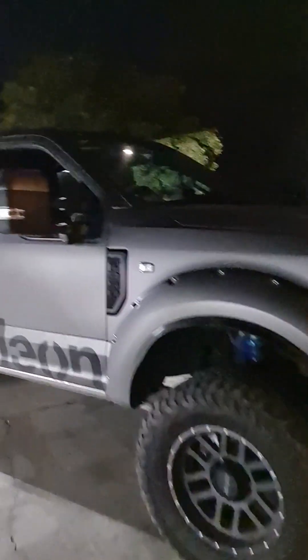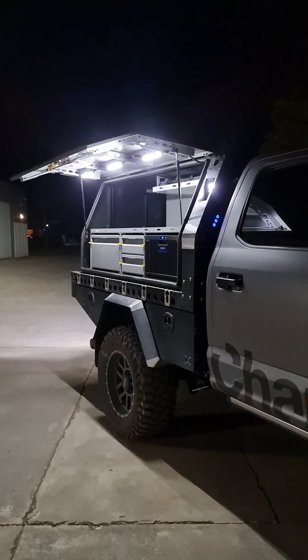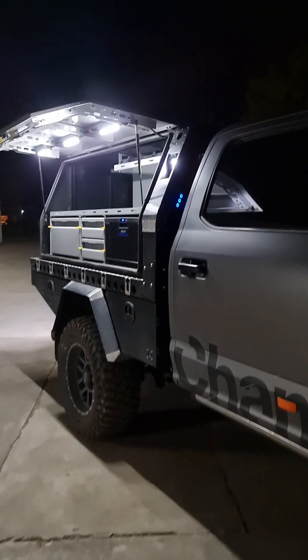We've developed a nice little mounting bracket that's just at powder coating now and will be back shortly. We've also extracted the rear lane change assist sensors, which were actually in the tail lamps on the tubs of these F trucks. We pulled that sensor out and made up a little prototype bracket which is just about through testing and working really, really well.